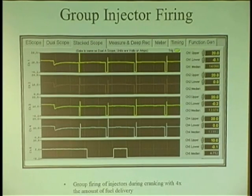But meanwhile, the customer didn't complain in the summertime. They complained as the colder months came into play. Well, you know, I don't know, my car's hard to start now. But she doesn't remember that the car was just serviced like 3-4 months ago in warm weather. So you have to watch out that when you're checking for fuses, there may be spots that are void because someone removed the fuse from that spot. So you say, well, I checked all the fuses. Yeah, you checked all the fuses over there. Well, the ones that aren't there. That's why it's always nice to go get a wiring diagram and find out where the fuse is in the panel. That takes care of your problem.